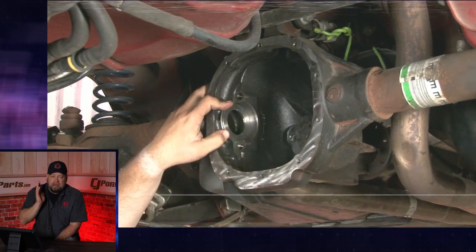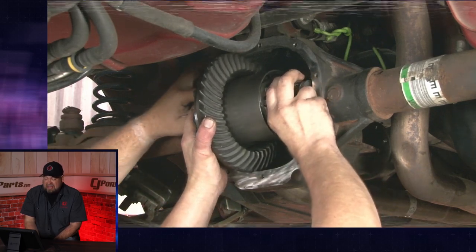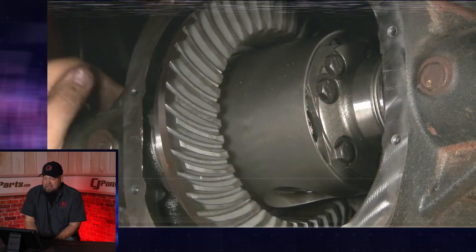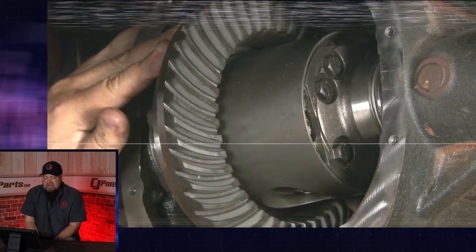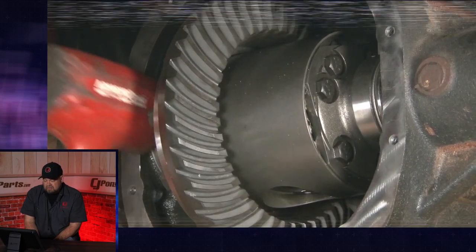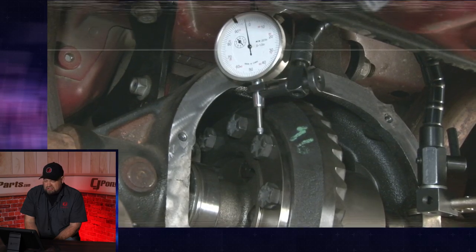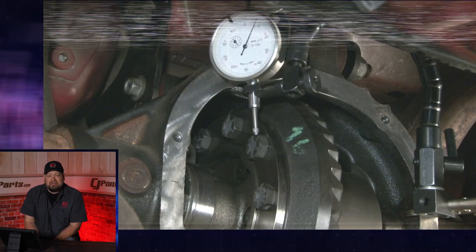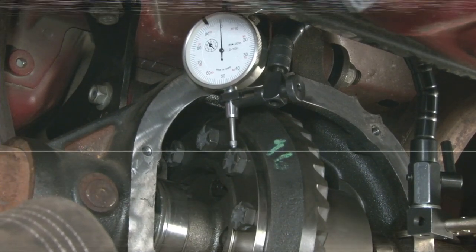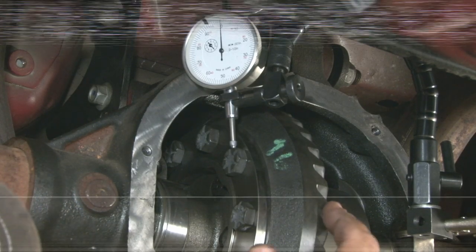This car had no problems with wear or anything like that. As far as I know, the owner hasn't touched it still. We did this video almost six years ago — this car went to the track, got raced a bunch, and he never had any issues with the gears at all. Just lots of little things to remember. The measurements are important and there's lots of things you've got to get right to do this installation. You want to check the play — I want to be between 9 and 11 thousandths. Opinions are going to differ on this, but we found keeping in that range is going to be the best for it.